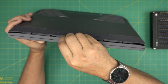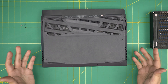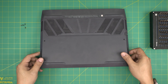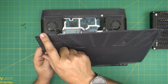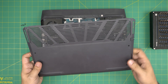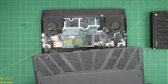Work yourself all around and listen for click sounds — once you hear those clicks, the cover is coming up. It's very important that you lift the cover from the front of the laptop, not from the back. Wiggle it around, bring it up, and pull it toward yourself, because there are tiny hinge clips under the back rail plastic. If you yank it up from the back it won't come out or it will break the hinges — lift from the front at 45 degrees and pull it back.